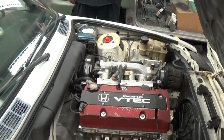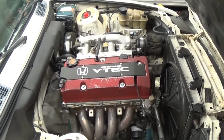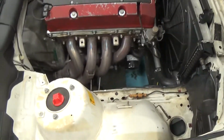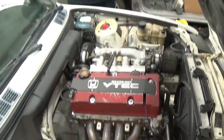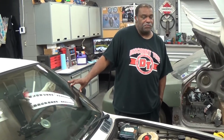There's nothing that really needs to be modified. There actually is nothing under the hood that needs to be modified. This bolts right into your subframe. If you have an aftermarket set of M20 mounts already, you reuse the mounts. We supply the brackets with our kits to reuse the stock mounts, because we figured a lot of you guys have already changed those out.